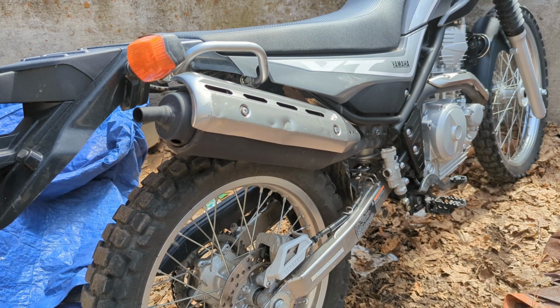It's good to clean your spark arrestor because I guess carbon deposits can build up on it, and what that does is it just kind of clogs the exhaust system. Just for your information, this isn't a California model, which has even more strict emissions, but obviously if that's clean, we're going to get more airflow and more power.